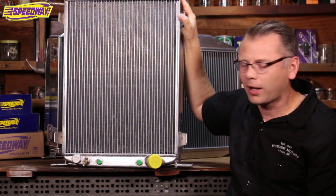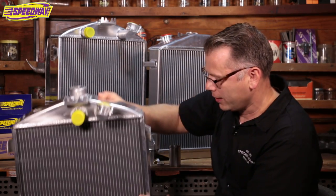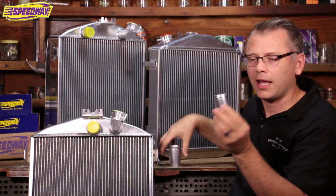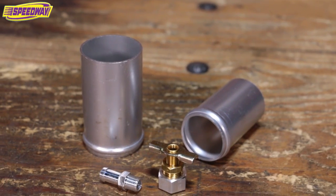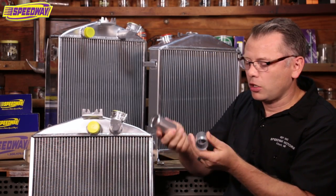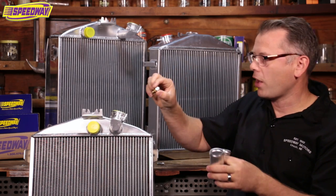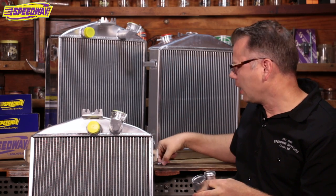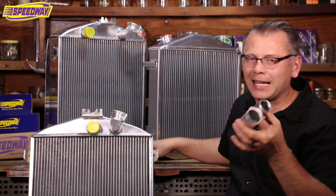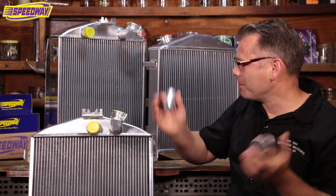Seems like a lot of work, but holy cow, it really wasn't bad at all. The nice thing is Speedway Motors has a little piece on the shelf that comes in really handy — it's a little water neck kit, and you can see the part number right here on the video. You get two new necks, a new petcock which I used — had that welded in, it's got the bung and everything — and a little extra nipple for the top if you need it. This kit really came in handy, and for a song and a dance I was able to switch my port on the bottom, no problem.